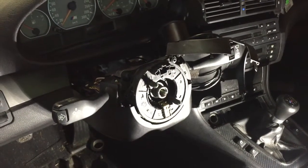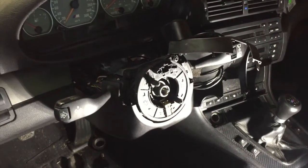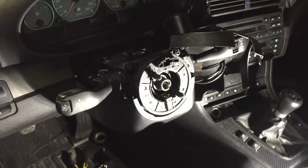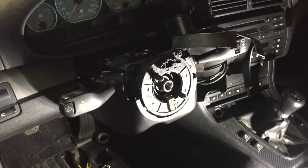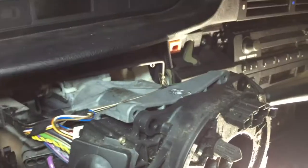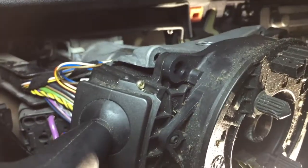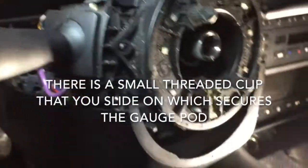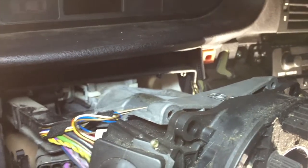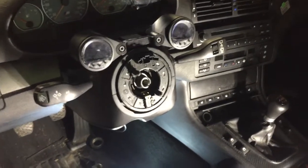It was a little bit of a pain to get that clip right, so I decided to go ahead and remove the steering wheel. If you want to do that, there are videos out there — you take all responsibility for removing your airbag. Anyway, I managed to get mine off and I'm just going to mount it now with the steering wheel off. That's the way to do it. I thought the instructions said you didn't have to take the steering wheel off, but once you undo these four bolts it just slides right in — that's the way it should be. I lost an hour just kind of messing around with that. So I mounted up the gauge clusters with the steering wheel off — so much easier, this is definitely the way to do it.